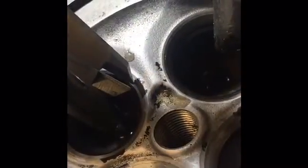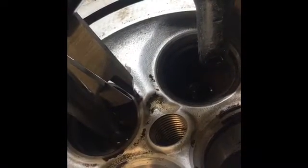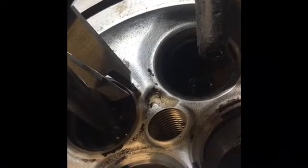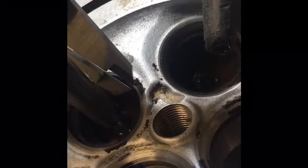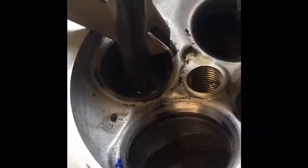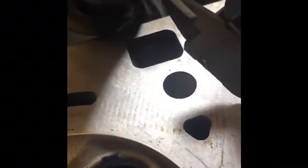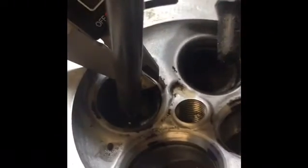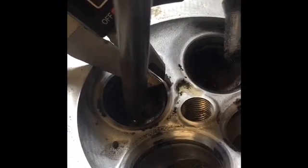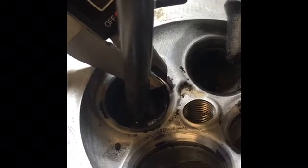So what we'll do now is figure out if we are still above our minimum spec, and if so, then we'll go ahead and cut out our 60-degree angle. And let's check the minimum spec. Alright, so we are at our minimum spec of 55 thousandths. We'll come in here and check and see how we are doing. And if you can see that, we are slightly larger, not by much, but slightly larger than our 55 thousandths minimum